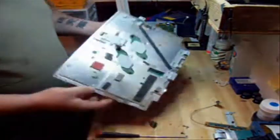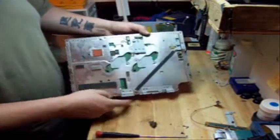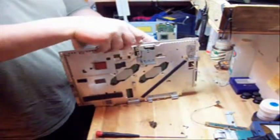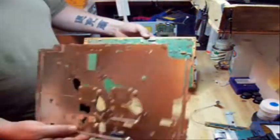Now that that is unplugged, you're going to hold the cage with these parts here facing down — remember where the power supply plug was. Put that part facing down and we're going to split the cage. It comes off like so and you lift up.